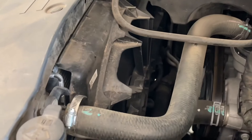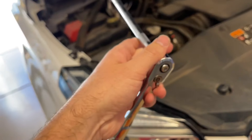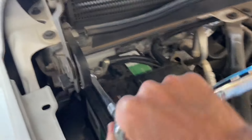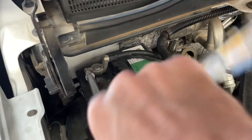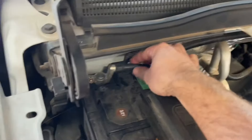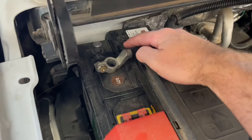As you can see here, we turned it off and the fan continued to run. So we're going to go ahead and take our 10 millimeter socket with an extension. First, we want to disconnect the battery since it's running, so we're going after the ground cable — make sure you don't do the positive one. We'll take our 10 millimeter, loosen up the negative battery terminal, and lift it up and put it out of the way.